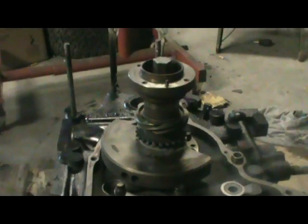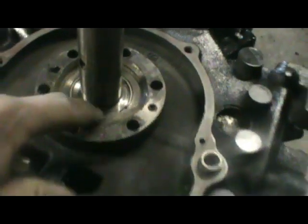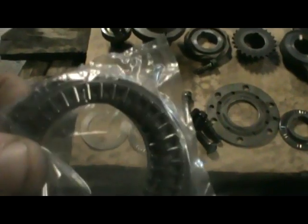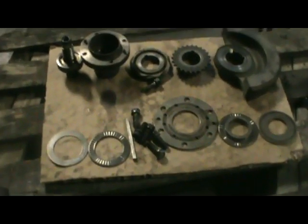So I'll make some videos as I go along. I took everything off — the front stack — right down to the front stationary gear. You can see it's all lined up in order of how it goes. I have the new needle bearings, which are actually from an RX8 — same size but a higher speed rating, so it's a better bearing. That's what they include in their kit.